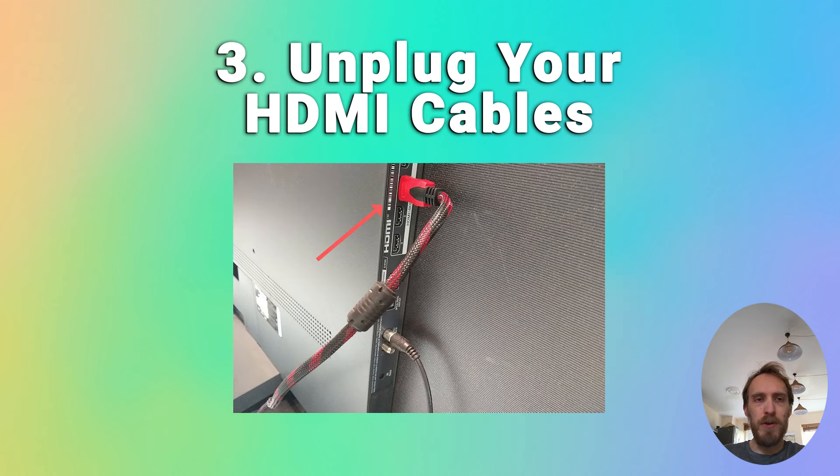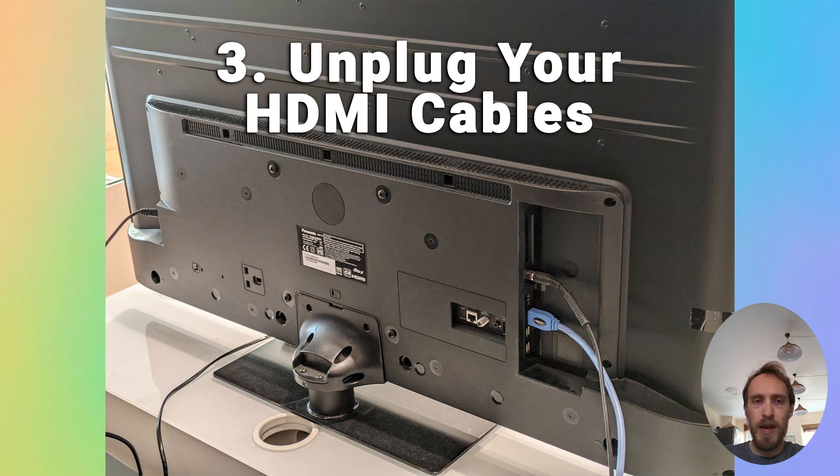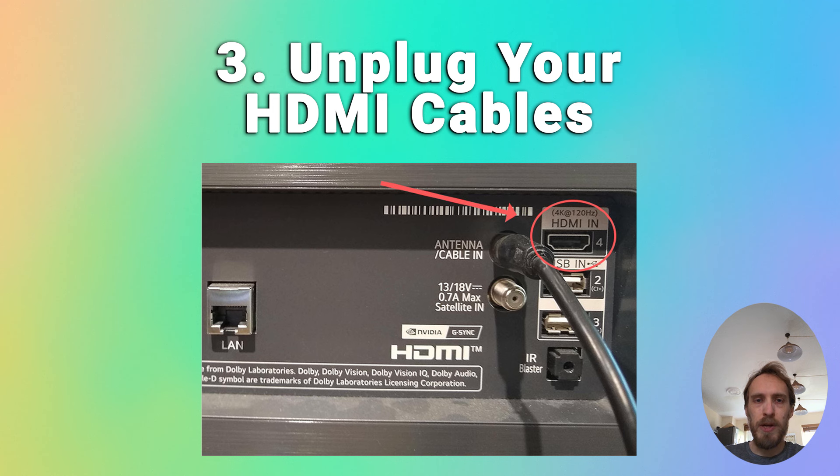About 5% of users have an HDMI problem — either a faulty HDMI cable with a break in it, a damaged HDMI port with damaged or broken pins, or a poor HDMI connection between the cable and connector. Start by removing all HDMI and other cables apart from your power cable, then switch your TV on. If the problem's gone, check all the HDMI and other cables for damage, use compressed air to clean the contacts, and firmly reinsert the cables. If it hasn't fixed your problem, try a different HDMI input located elsewhere on your TV, as HDMI slots on a different part of the TV often have a different connection to the mainboard. If your TV is now working, you'll need to troubleshoot your HDMI cables and connected devices.